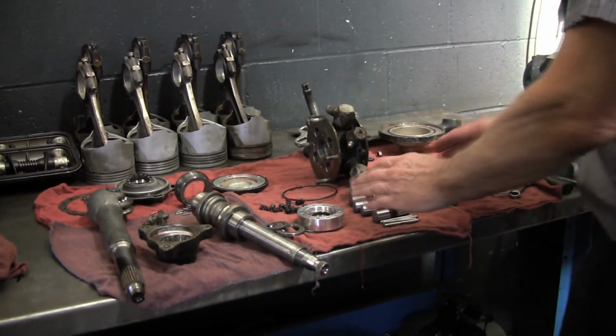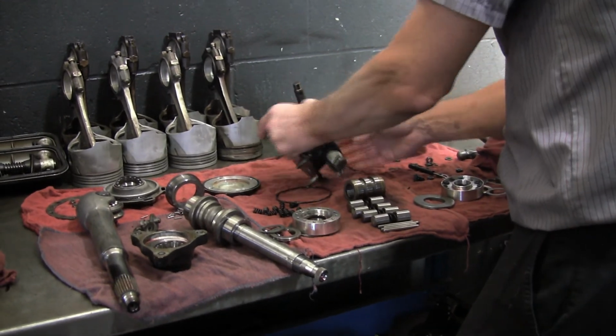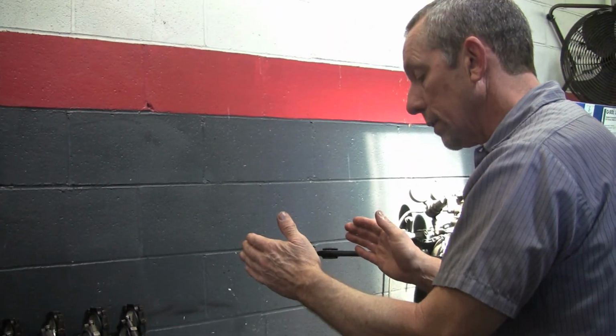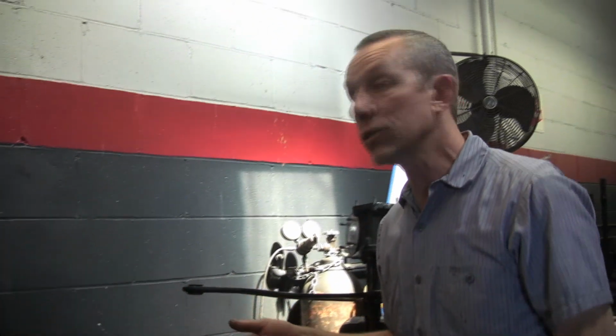The Silver Cloud 3, they got rid of these spring things, and they just had spring washers, which fit into something like this. Belleville washers? Yeah. What that would do is they boosted the pressure on the pump because the Silver Cloud 3 has much easier steering. But it had another problem that came along with that: they'd get a shudder in the steering. A lot of times there's too much clearance in this. There were some Band-Aid fixes where you restrict the orifices going to the ram. And then they had the step-down hose.